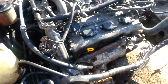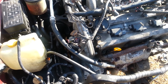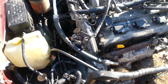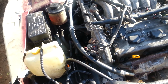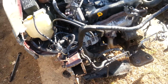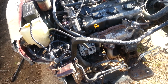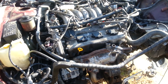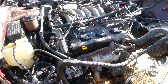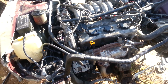So take this engine apart. I think I'm gonna clean the valves up, do the timing over, then put General Technology valve springs in it, and put an HR oil pump in it. And then rod bolts. After the rod bolts, I'm gonna put it back together. Valve lap so it's not leaking, and then put it back together.